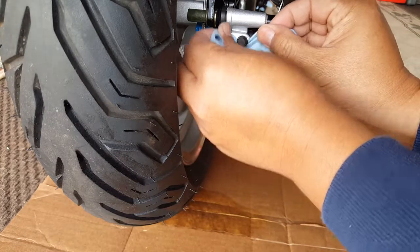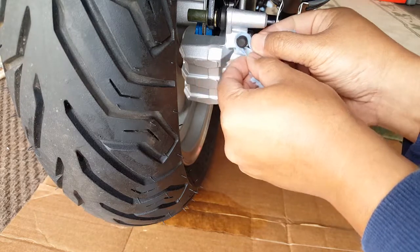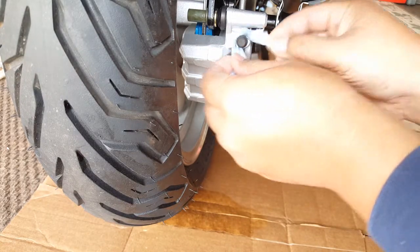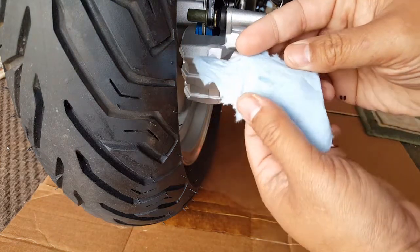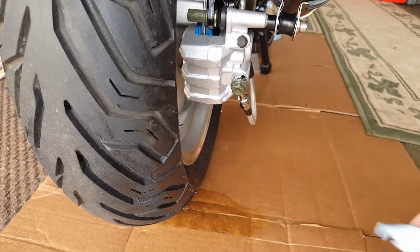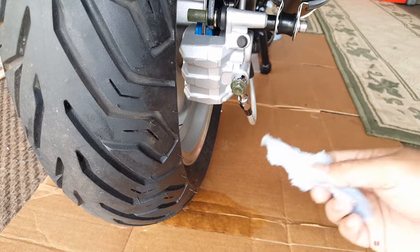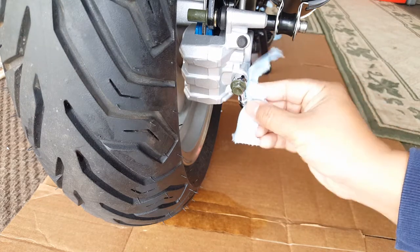So here we go. Let's go back to this little wraparound. Now this has been vacuumed already. It's been sitting there for a day. So let's see. Yep, see, getting a little bit of wetness right there. That's actually coming from here. So that's probably why it's not sealing that well, because of our banjo. So we're going to try to get that resolved. So here we go.